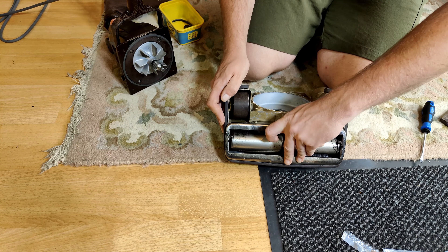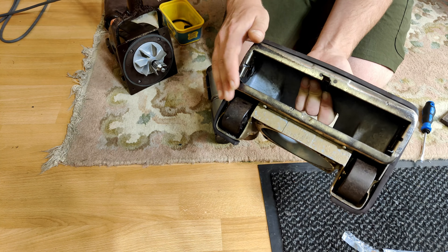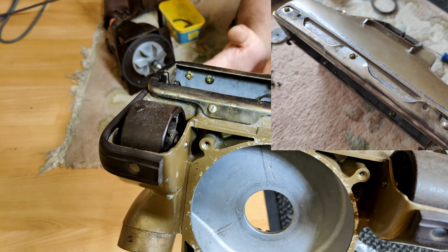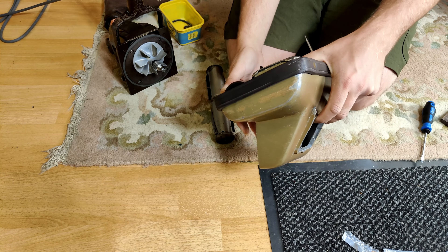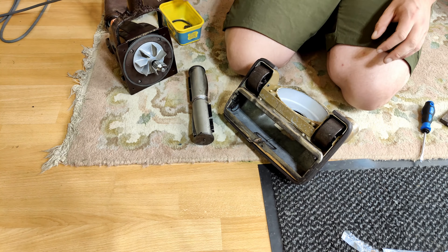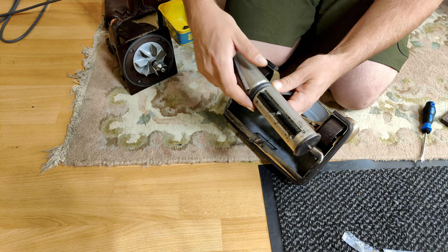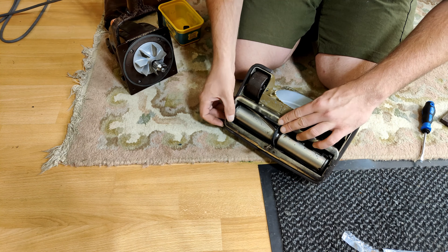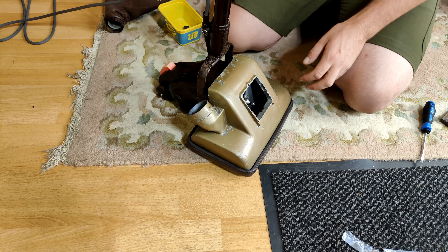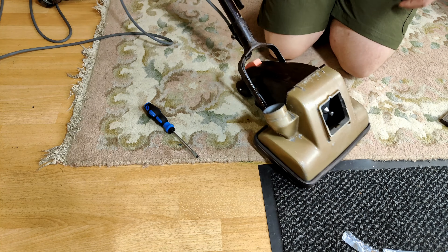Now under here a lot has happened. If we lift up these two bits here - which never used to work before, as you remember - we do have to push the brush roll out because there is no belt. I have replaced this entire part here and basically screwed it on; if you look in there now there are some nuts and bolts which work very well indeed. At the front you can see how the nice brown 119 bumper has fitted on - I had a gray bumper on it before from a scrap machine. So this bottom bit and bumper is from that. We can take our belt, put it on our brush roll - we have the same brushes, which were fine, and the same bearings, which cleaned up well - then bring these two together and do up the motor-to-brush-roll screws.